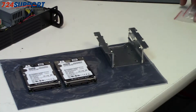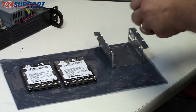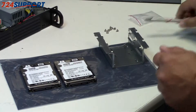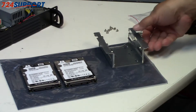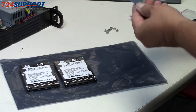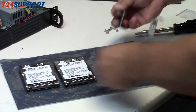Assembling the drives — this is annoyingly difficult, but fully functional. The 2-in-to-1 adapter works great. In this situation, we're going to be using it in a production reliability-critical monitoring server. You don't want the monitoring server to go down, so we're going to use RAID 1. HD cables come out here, and a little cutout gives you room for that. But physical installation is kind of a pain.